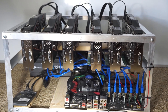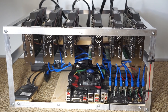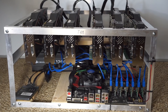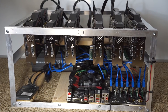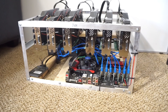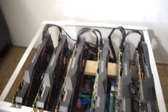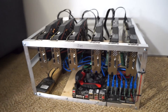As a quick recap: we've installed the CPU and memory on the motherboard, secured the motherboard to the mining rig case, plugged in the power supply unit cables to the motherboard and various components, plugged in the solid state drive using the SATA cable, plugged in all of the PCI Express USB riser cables both to the motherboard and to the GPUs, and set the GPUs in place — ready to start mining your favorite cryptocurrency.